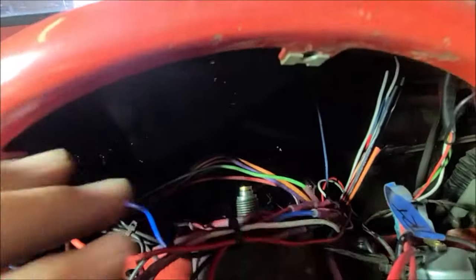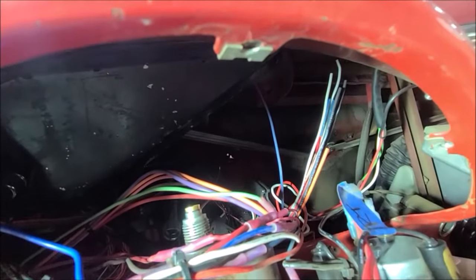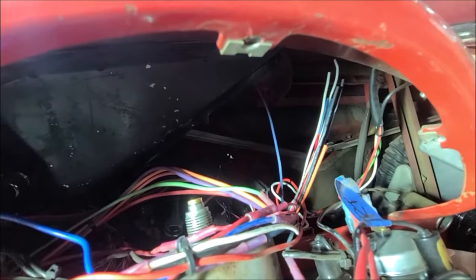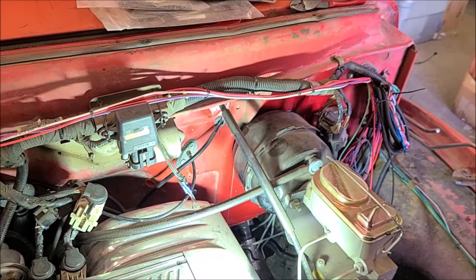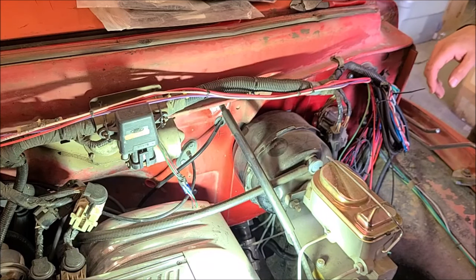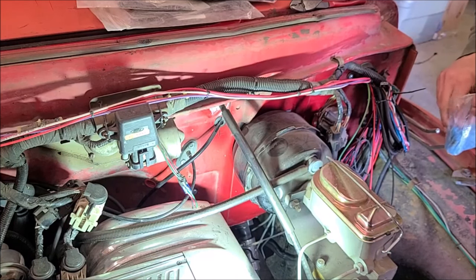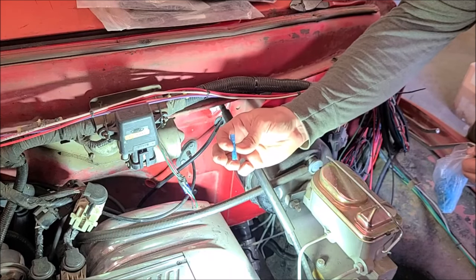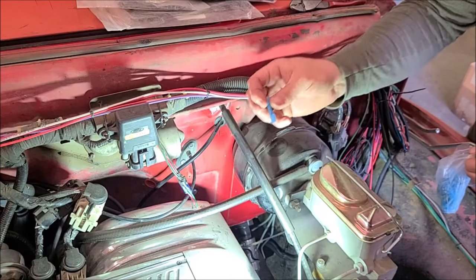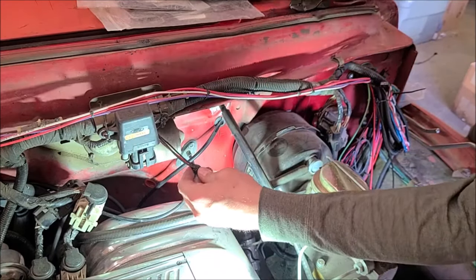In behind this dash, we've got this blue wire to the left that's going to go to my wiper switch as labeled. These little bundles on the right side that don't have ends on them, I'll just tape them back up for future use. So I've got the inside wired up and the switch is wired. Now we're going to hook up the motor. I'm going to splice into this using butt connectors that have 3M shrink tube on them, so I can heat these up — gives a nice tight, weather-tight connection.